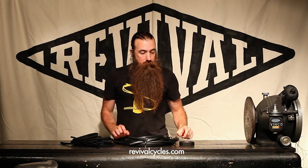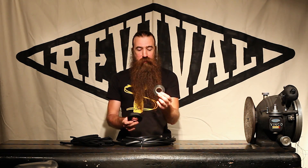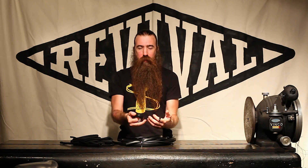And we've got these. Starting with tape — you've probably seen electrical tape before. This is not usual electrical tape. This is usual electrical tape. It's made of vinyl and it's not that great. It's all stretchy, and once you get this on your bike and loom the whole thing up, then splash a little gas on it accidentally, it's going to turn into this gooey, mushy mess of garbage.